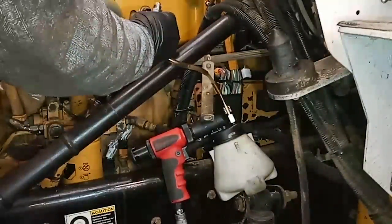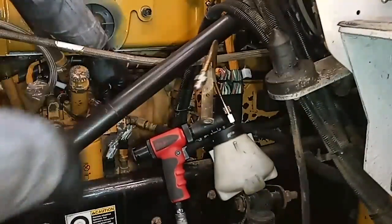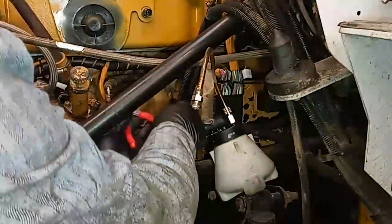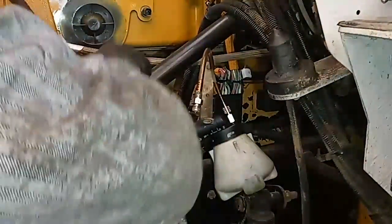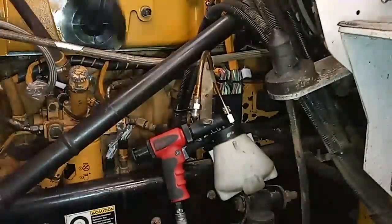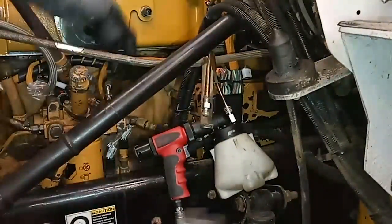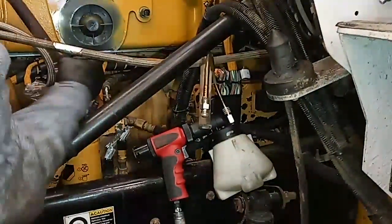Once it is disconnected, you're going to quickly thread it back on. Some air is going to get back in the system — you can't connect it before any air is pulled in. I've been using these Knipex plier wrenches, which are really good in place of a crescent wrench — I'll put a link in the description. Anyway, we connect that supply line back and now the entire system is sealed.